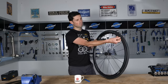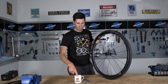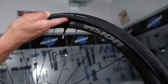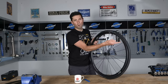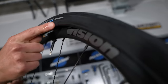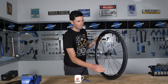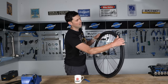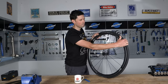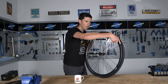The first thing you're going to need to do is remove a little section of tire bead back ever so slightly further than the section where you run into difficulty. Take your finger, dip it into your soapy water solution, and then apply it on the inner edge of the tire bead. Work your way all the way around. I wouldn't worry about getting it on the outer surface because it's just going to make the tire a little bit slippier and harder to get hold of. Once you've applied a tiny bit of this soapy solution, wipe your finger off on your shorts or a cloth, then get the tire on as best as you can with your hands. At this point, you can keep one hand on one side of the tire bead to stop it popping off further. Take your tire lever and carefully insert it underneath this section of tire bead, ready to lift it up and over.